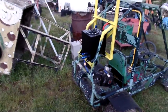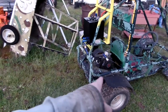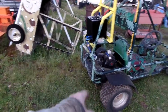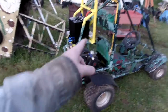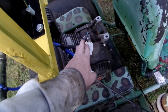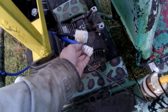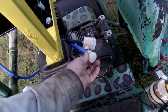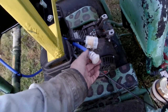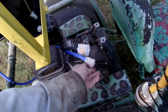I haven't tested everything out yet — I got to set the idle. I tightened the chain, lubed it up, put air in the tires. I put a second vent on the motor; this vent goes to the port that's built into the valve cover, and then I drilled another one.